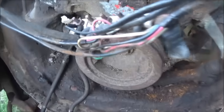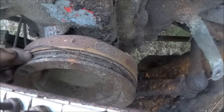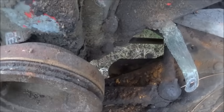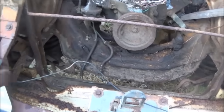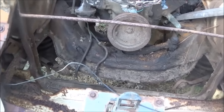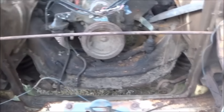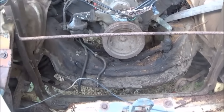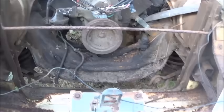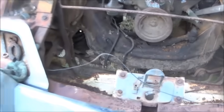We'll start cleaning some stuff up here. We may or may not pop that pulley off. We've got pieces of belt still stuck in the pulley — this thing definitely hasn't been started in a long time. Everything is about rotted off of it. The transmission lines don't feel bad but they worry me. I'm afraid the pressure is going to be my biggest fallback in this whole ordeal — whether the transmission is going to be any good or whether it's going to pour fluid.